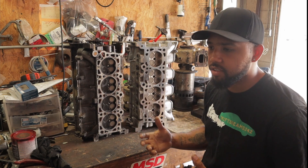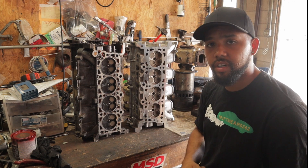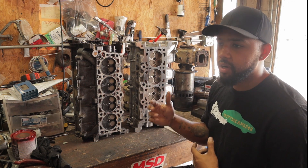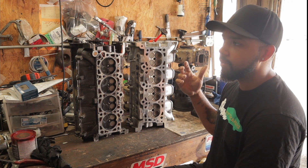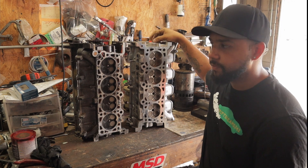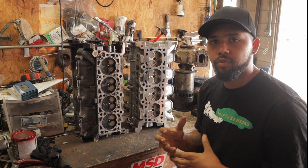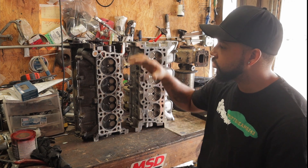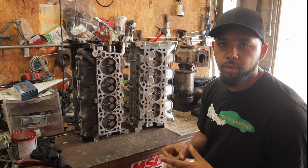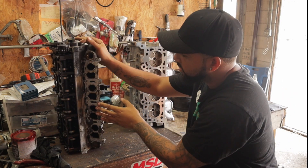The exhaust port is 1 inch 200 thousandths — same port on each side. So you might ask yourself: if they have the same valves, what makes these heads different and what makes it worth it to swap over to the C head? The real reason is that the B head was infamous for having a bad air-to-fuel mixture because of the way air and fuel was introduced into the motor — using intake manifold runners, the split-port design, two ports per cylinder, and stuff like that.